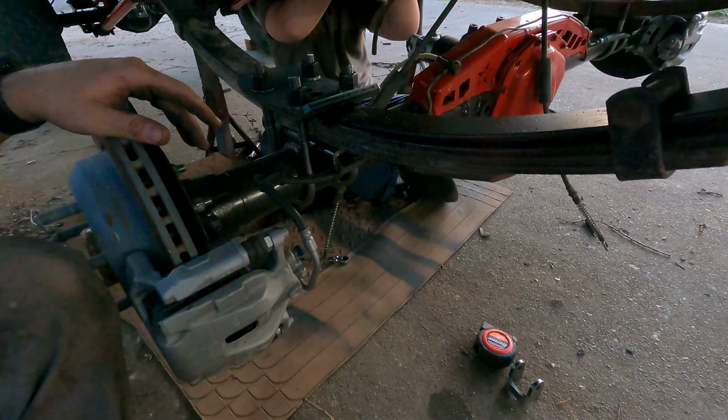We got both axles here, got the rear one out. So this one doesn't have any brake lines on it, hard lines, and we're gonna reuse from the James's because it already has an extended cable on it for the rear. And the only thing we're gonna do is, because that one has soft lines on that side, we're gonna take this off, put it on that axle, and then flare our new ends where we need them instead of where they're going inside the caliper, basically, or drum brakes in this case.